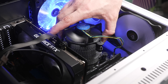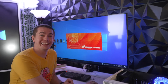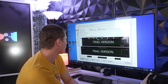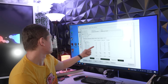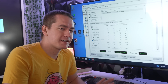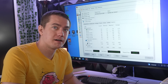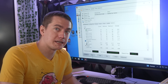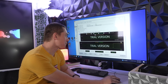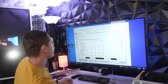It's already ramping up, so I'm expecting temperatures are already quite high. Starting the stress test — 76. Some might call this worse. 77. As long as we don't thermal throttle, this works. The hottest core is 80 degrees; we've gone up about 20 degrees. My suspicion is that the fan isn't strong enough to push all the air out — if we use a bigger fan we should see better cooling. We're at 85 degrees and not even two minutes into the test. We hit 89 on core two. 90. 91. Let's call it there — it's not thermal throttling. That's all I need.